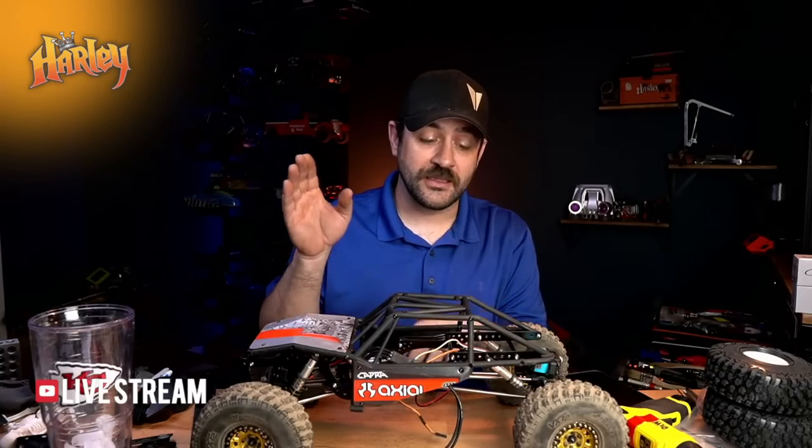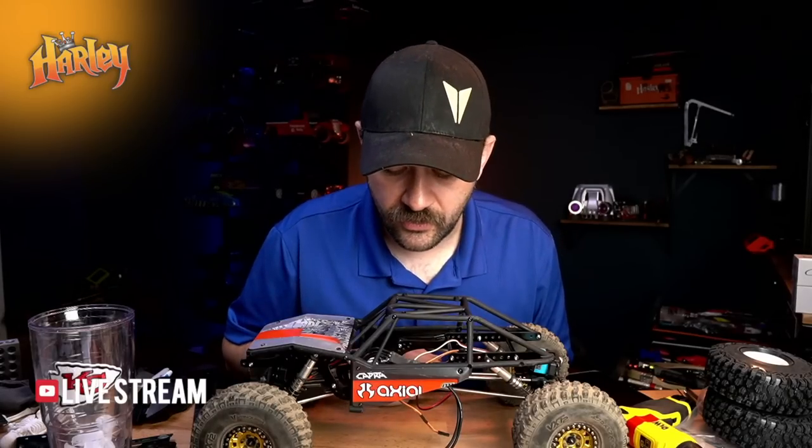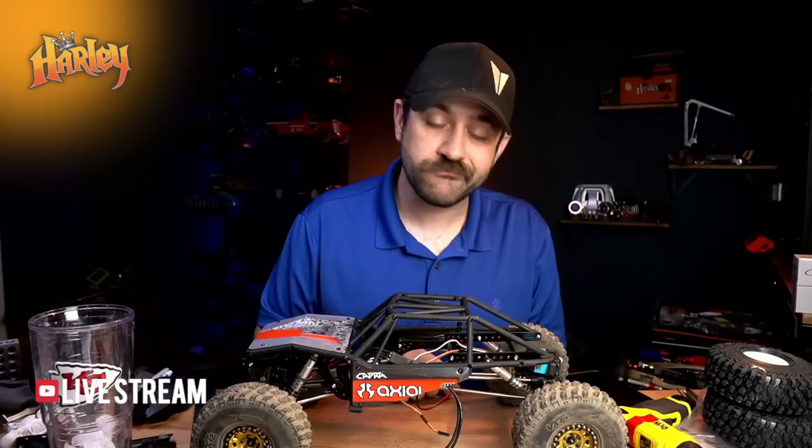You didn't get the bent high clearance links in the rear. Missed the whole link section. These are just links that I had around, so I kind of put some things on it. I'll take these out and bend them myself, and we'll put a good rear bend in them midway, get them tucked up there. Rear uppers are going to be a different situation. I've got to figure out exactly, either get the right ones or figure it out. It'll be fine. I am unconcerned now.